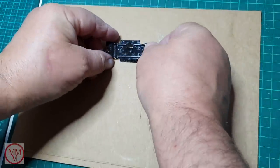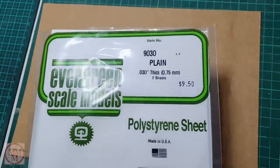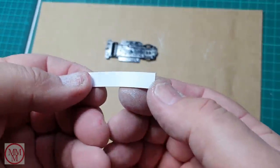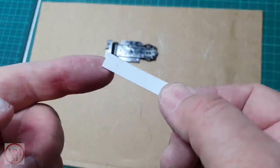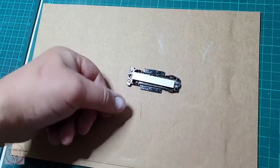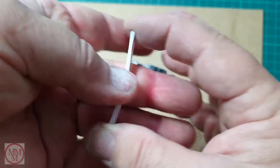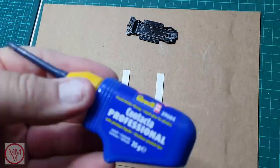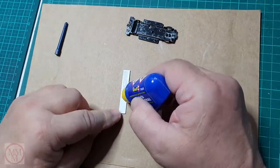Here's the base - I've removed the ruined suspension part and I'm going to have a bash at making one out of this 0.75 millimeter thick polystyrene sheet. I've cut two rectangles out - I was just going to go with one but it didn't seem rigid enough, so I'm going to glue two of them together and make a laminated leaf spring, I guess you could call it.